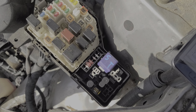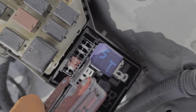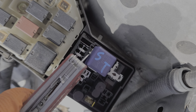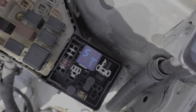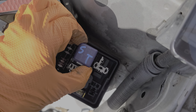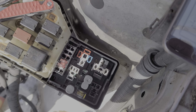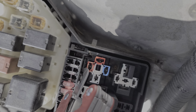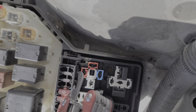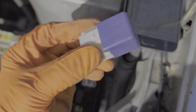As far as removing the starter relay, it's retained on the side with a little tab. So you've got to reach in there and pry the tab away, and while you're holding the tab to the side, you can grab the relay and wiggle it pulling up. Let me give you a close-up of that tab — you can see it just pivots over to the side. And you can see on the starter relay that's the tab that it locks into.